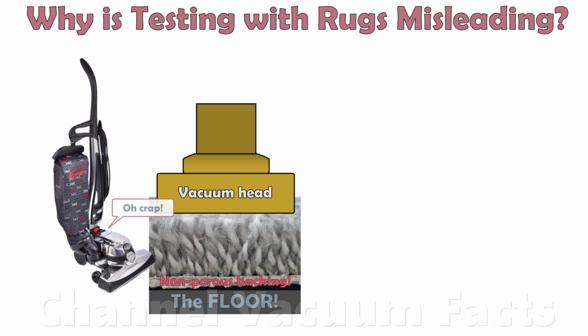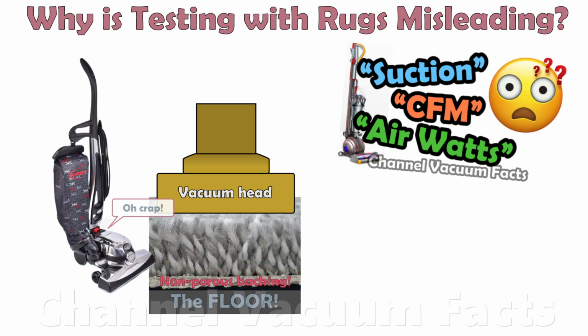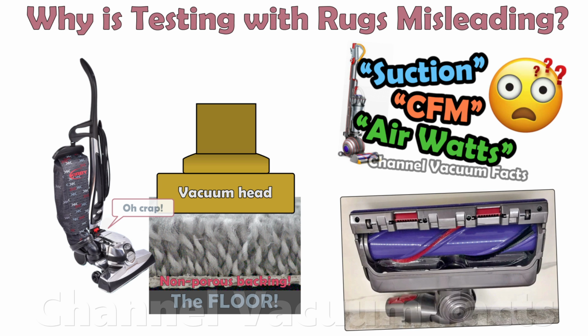Big airflows may be present at the open cleaner head on a Kirby, but put a fitted carpet there and it will drop at least as low as any cleaner, if not more. Those big airflow numbers are a big illusion in practice, and a tiny portion ends up through the pile. But amateur videos try to trick you into thinking it remains unchanged and stays enormous when on a fitted carpet. It's hoped you don't understand the importance of suction combating carpet resistance to avoid airflow loss. And as discussed in the video with the fifth link in the description, there's more to cleaning than suction and airflow alone, and cleaner head design has a far bigger impact.